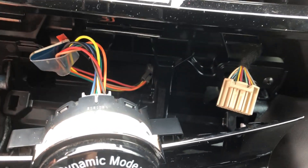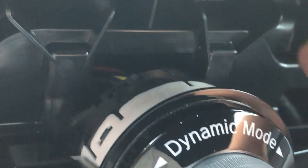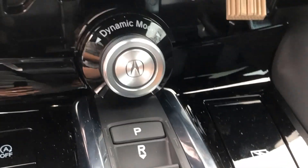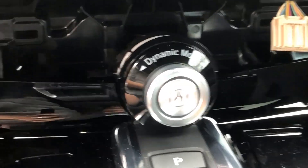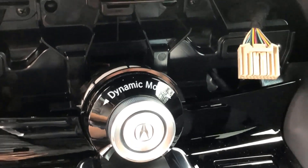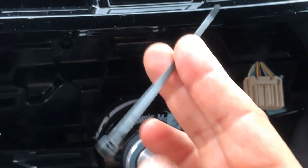There's a lot of space in there so we can tuck it back in. Before pressing it down, you can see the wires aren't pinched at all — they're free in there, going off to the left hand side and curling around to the normal harness. I prefer this method since it's straight back; there'll be no pressure or pulling and it probably won't rattle. You can also use tie straps if you feel like you're getting a rattle.